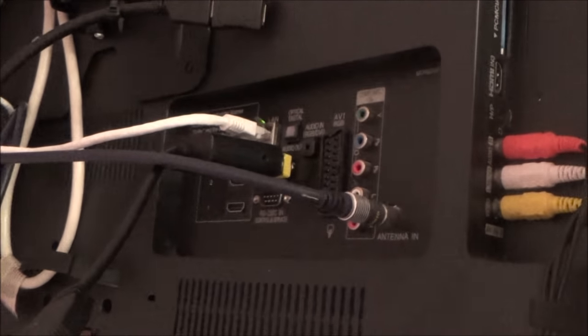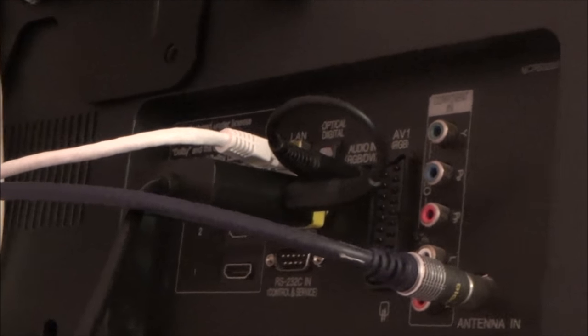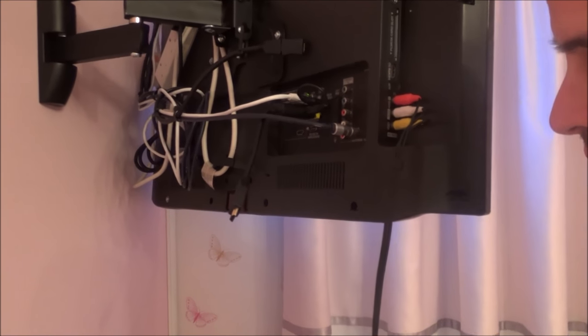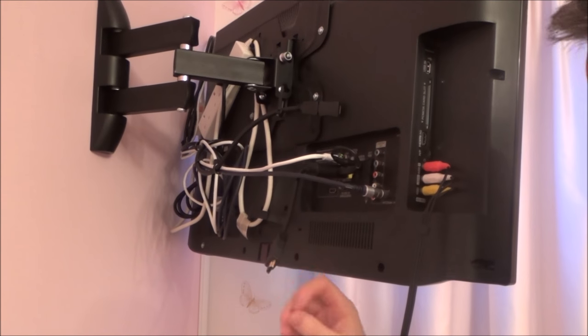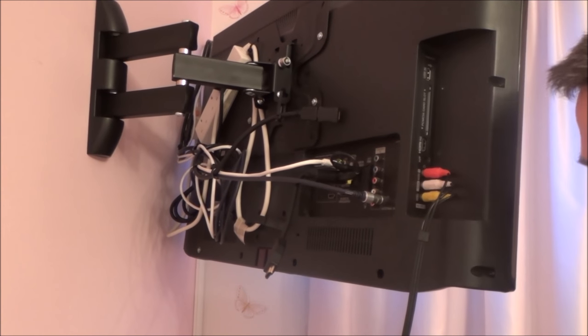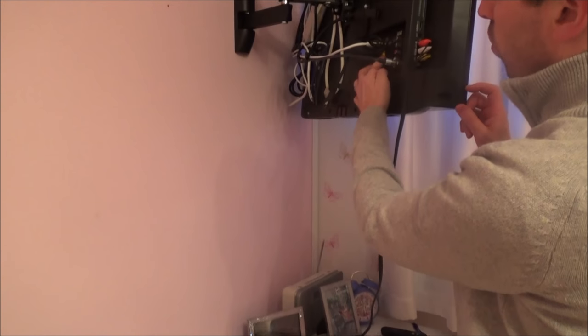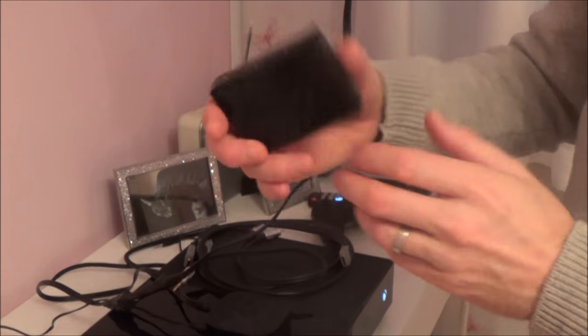All you would have to do is connect the HDMI lead from your Xbox into the adapter. The included lead is going to be a bit short, so you may need to extend it using an HDMI coupler and a longer HDMI lead. Because I want to connect up both my Roku media player and my Xbox One but I've only got the one VGA input, I'm going to attach everything via a little HDMI switch.